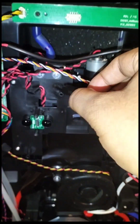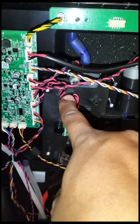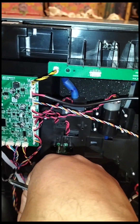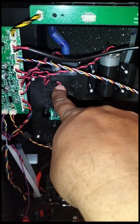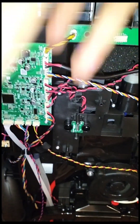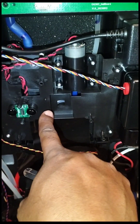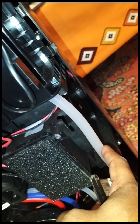This is the solenoid valve and this is the pump. The pump creates suction, and when the water goes down for the mopping function, this pump creates the suction and this valve puts that suction under pressure to the cleaning water tank so the water can go down. After mopping, the same suction — the solenoid valve turns this suction to the dirty water tank so the dirty water returns.